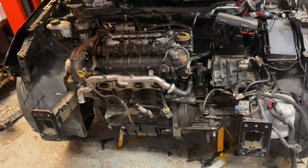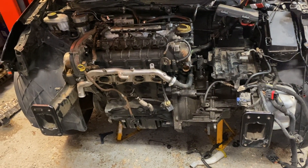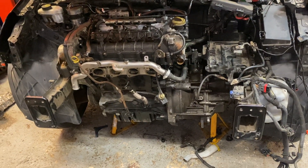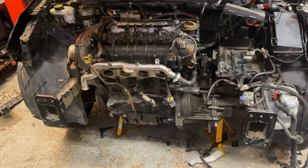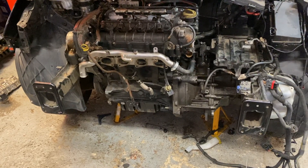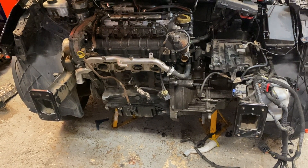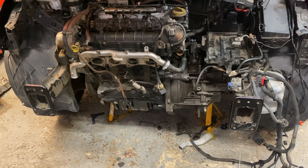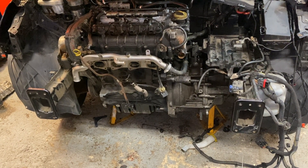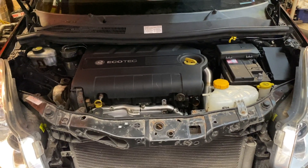The engine's back in. I'm starting to assemble it all back up now — joining bits like the clutch pedal, all the wiring, the fuel lines at the back are all sorted. So now it's the slow process of rebuilding it back up: the manifold, the front end, the battery. Because we stripped the wiring loom so far down, I need to start loom-taping all that. Next job is to loom-tape all the engine bay loom, get it all sitting where it needs to sit, get it all P-clipped up and tidy.